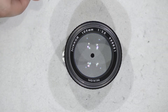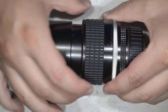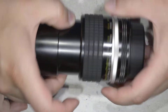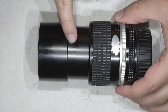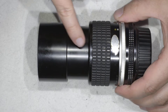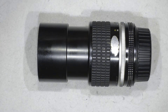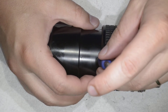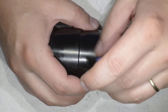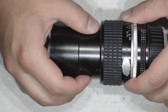I'm going to show you that it is extremely simple to reach that part of the lens and do a cleaning. We start by taking out the shade, and then somewhere in here we have this screw. We're going to concentrate on this screw — let me get a 1.2mm screwdriver, which is the standard size for Nikkor lens screws.